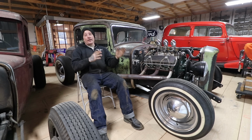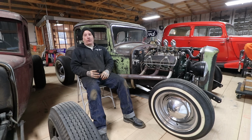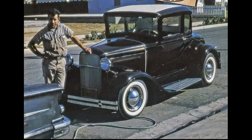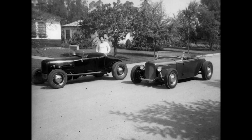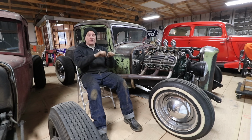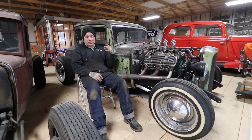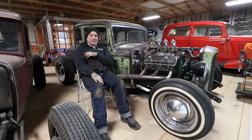Now, within the subdivision of that poverty cap or dog dish hubcap, there are the high dome or beanie caps, as they called them, which was a common aftermarket part that was put on a lot of these early hot rods. The main reason was that they used early Ford drums or hubs, and especially in the rear with the banjo rear, they have a high dome because it covers the stub that sticks out from the hub, that's really only on a banjo rear. The Schroll coupe has a set of these type of hubcaps. They were advertised in like every magazine.